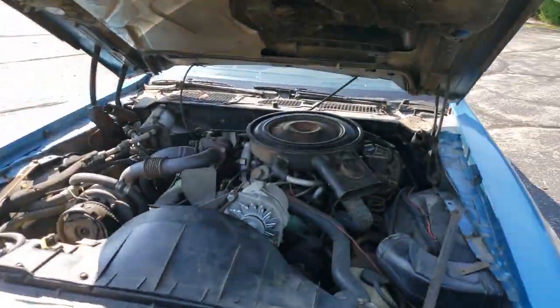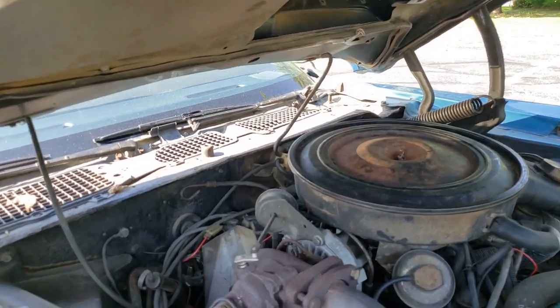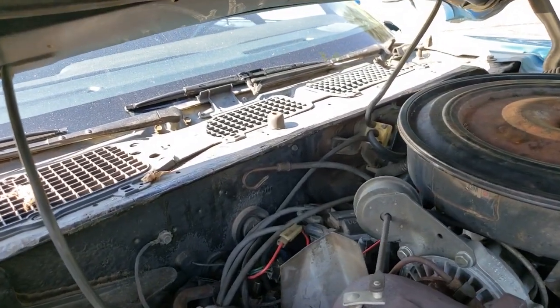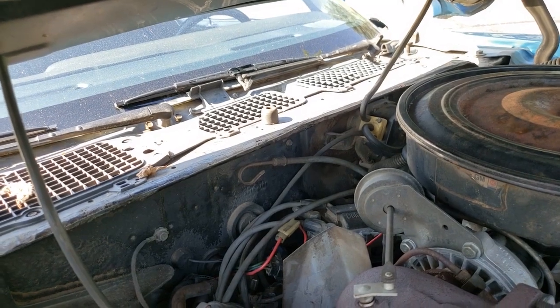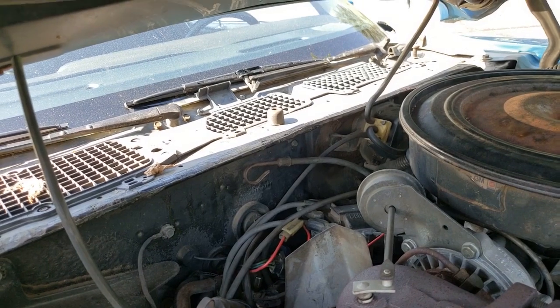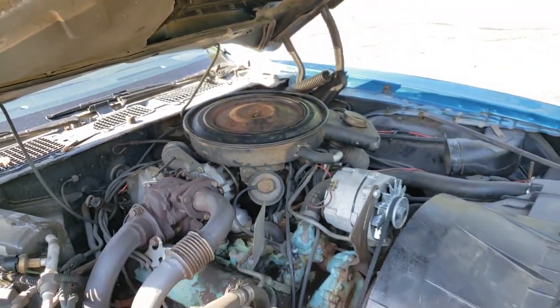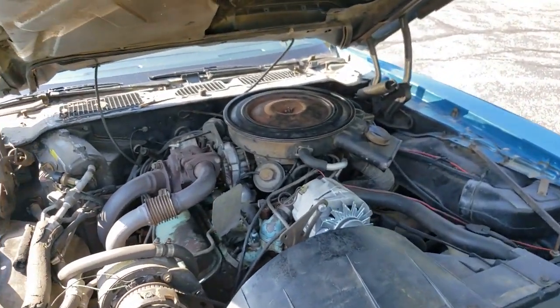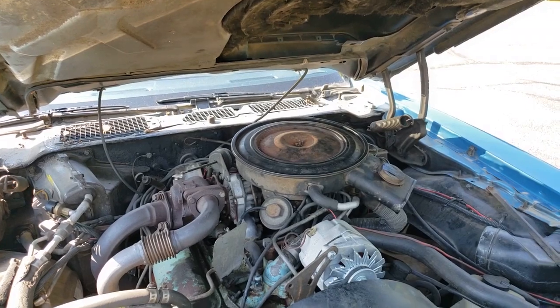One other thing that I look for, the dipstick. Why am I looking at the dipstick? Well, I'm looking at it because it's a big curved piece, and it comes up behind the firewall right above the distributor. That's the turbo dipstick. A non-turbo dipstick is really short and it would be over by the power brake booster. But because the carburetor is offset, they moved the dipstick and made it longer.